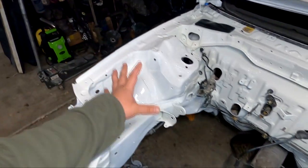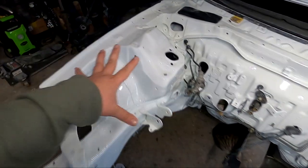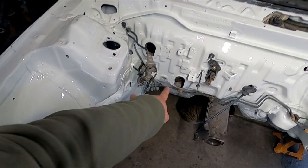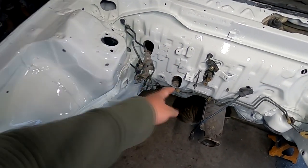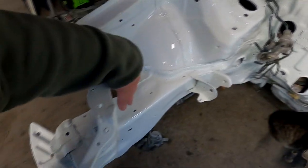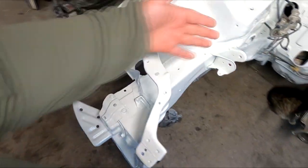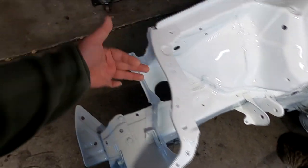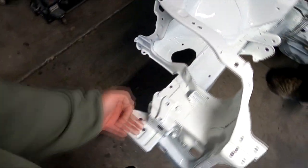Now, typically, if your engine bay is untouched, you have literally your fuse box that sits right here. The chassis harness that comes from the firewall coming into the engine bay comes out through this hole, and there's a bunch of wires that comes along the frame rail. If you have AC, it goes across. If you don't, it stops right there. But you have all of the headlight, corner lamps, bumper lamp, the horn, all that stuff sits right here in this corner.